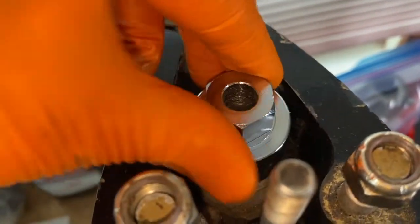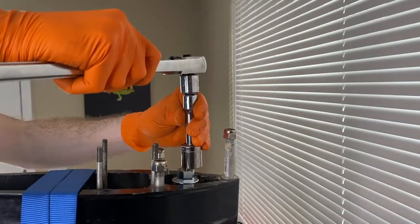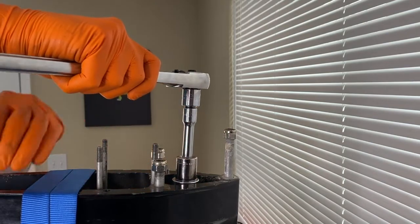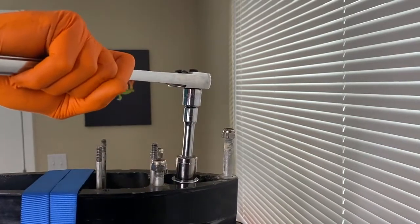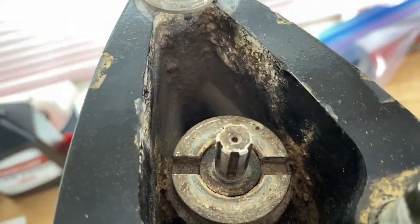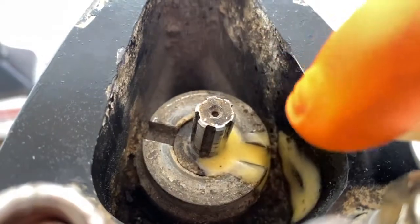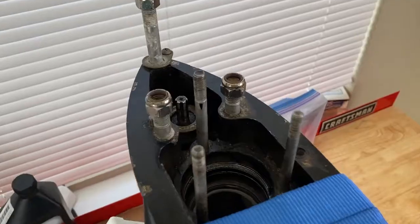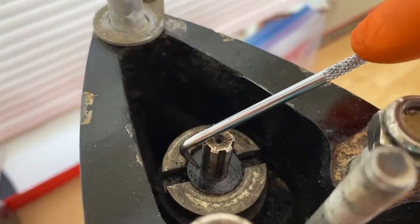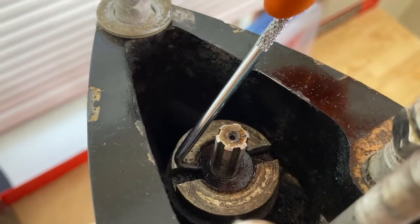I'll carefully slide the bushing tool in place — the teeth are down in these slots, as you can see. We will now use the ratchet, socket, and extension to loosen up this bushing. If it's like everything else with our lower unit, it is going to be on there very firmly — and yes, it is. After trying to muscle it and use the rubber mallet, it did not budge. I'm going to use some PB Blaster here and carefully spray the bushing. I'm going to let that sit for about 20 to 30 minutes. Back at it — we waited about 30 minutes. We also need to remove this rubber gasket here; you can remove this at the same step when you remove the metal washer. I've got a little pick tool, and in our case we will be replacing this.